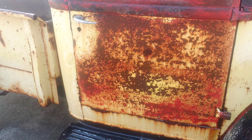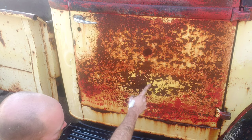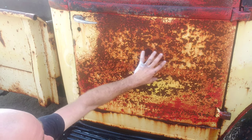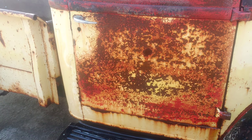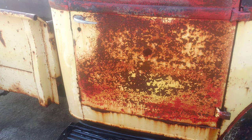A couple of things that did: the yellow got more vibrant and the rust stuff came off. If we wet sand, there's a chance we're going to lose a lot of the yellow, and I'd like to keep the yellow. So I think we're going to do the whole truck this way and see how it looks. If we have to wet sand down the road, maybe we'll do that, but right now I'd like to keep as much of this paint as I can. This door is honestly kind of the worst condition as far as paint goes on the truck. I'm not going to make you guys watch me do all that, but that's what I'm doing before we apply the mineral spirits.